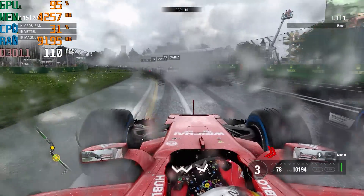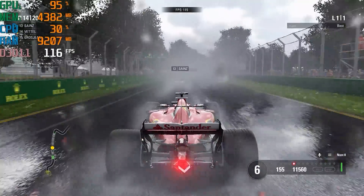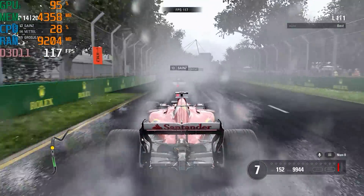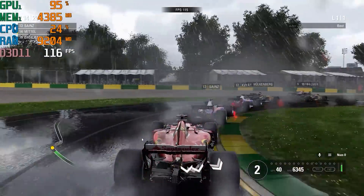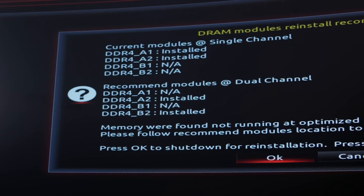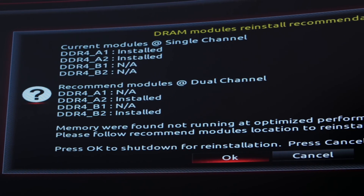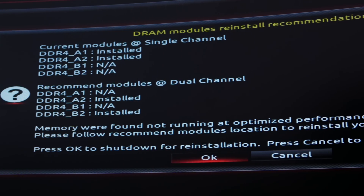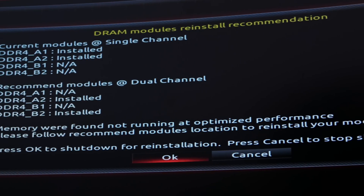You'd be hard-pressed to discern the two if shown side-by-side. I imagine this will be the case for most gamers in most titles, but today's most intensive titles are clearly discriminating between the two configurations, which is why it's important to abide by motherboard manual recommendations. I thought it was very cool that the Gigabyte Z390 Designer in my test rig warned me upon first boot that the RAM modules weren't seated in their optimal slots. The splash screen upon posting is a nice feature, and that's sure to save you from headaches.